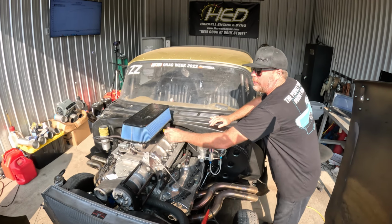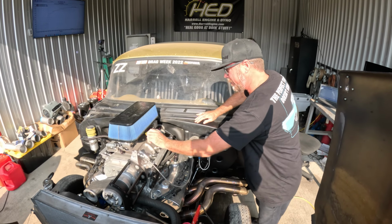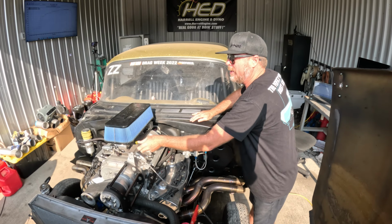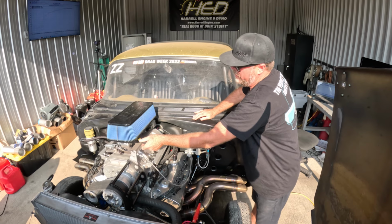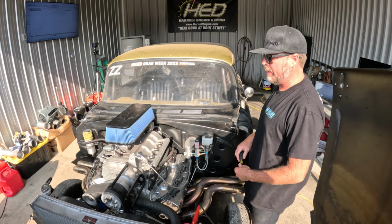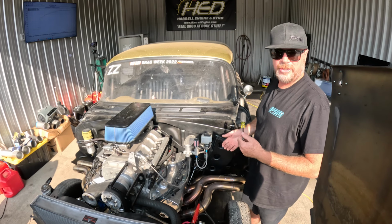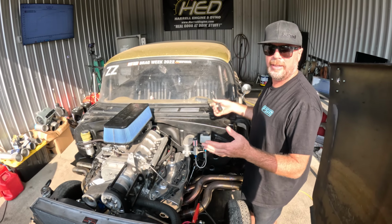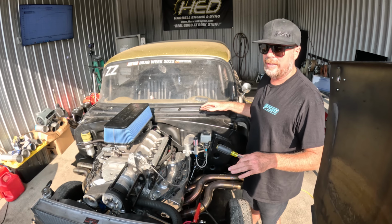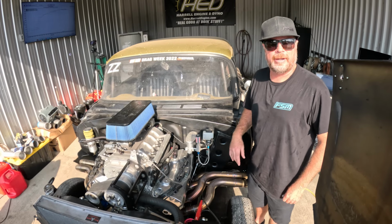Okay, we made a dyno pull, first one of the second day of our dyno test. We're down about 20 horsepower, and that could be from the air filter. What we want to do now is back that up by pulling the air filter and the adapter off, putting back what we had on there before, which was just the sheet metal bell, and making another pull to see, do we get our 20 horsepower back? Pete's gonna show you guys on the big screen what's happening during the pull. He's gonna show you ignition timing, air fuel, and you can look at the Holley data we have. This leads me to believe nothing changed other than we were down about half a pound of boost, which could be from this. I don't know. We'll take it off and find out. But Pete will give you a better explanation than I will.